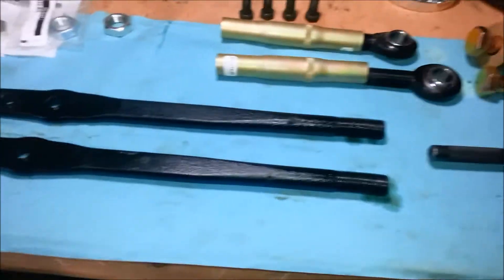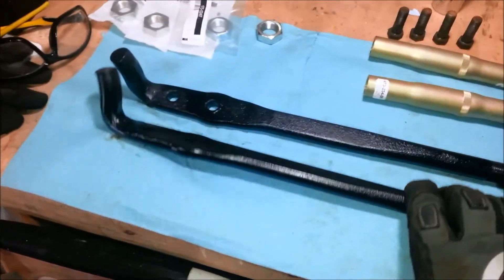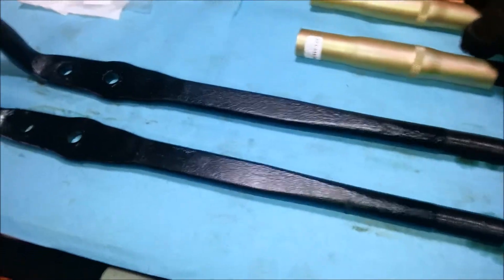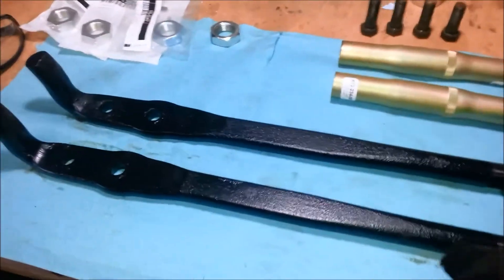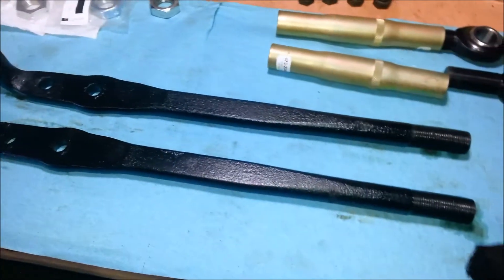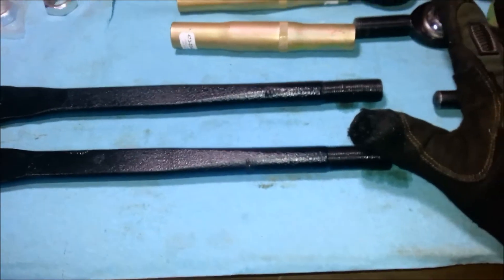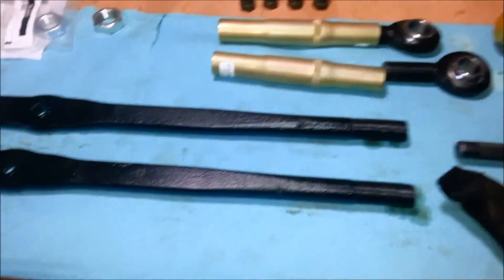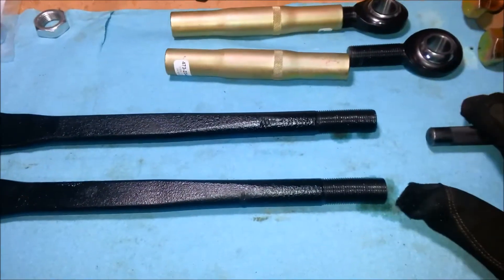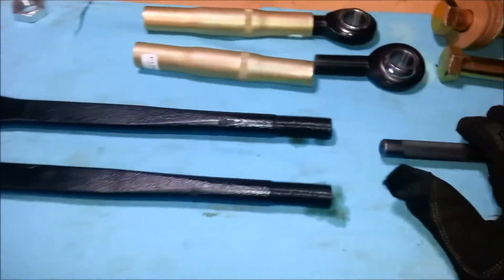So now we've got both strut rods all painted up. Threw a coat of chassis paint on the strut rods just to make them look a little better than the rusted piles they were. Next up we're just going to thread the pieces on. We've got a jam nut and a swedge bolt — thread the swedge bolt onto the heim joints — and we should have a complete assembly. Next up is going to be fitting these up to the suspension, to the lower control arm, and finding out exactly where we're going to drill the holes for our cross bolts.